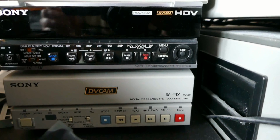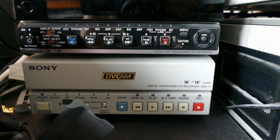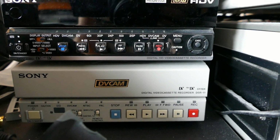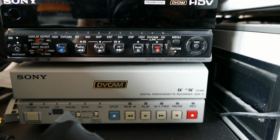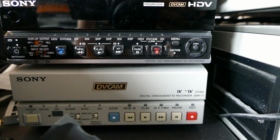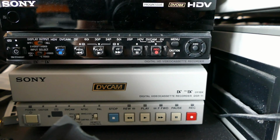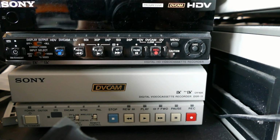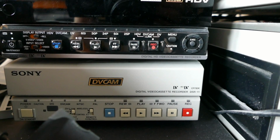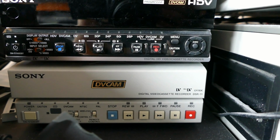And it's got another small design flaw, actually, I'll tell you about. If you're silly enough to stick a label on the front of your mini DV tape and you put it in there, there's a fairly good chance it will get stuck in the machine and you'll end up in a right old mess, because it doesn't ever get round to ejecting the tape, and it'll just sit there clicking and ticking away, and you end up having to strip the machine down to dig the tape out, which is annoying. Guess who that's happened to once or twice. So always look out for sticky labels on the front of the tape where the lid goes. They can foul some machines.